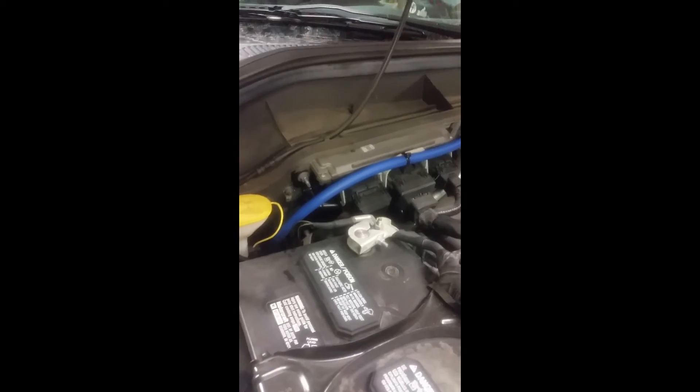Now you can see the filter is mounted to the side of the cab. The oil lines go up into the fender well, go through the fender well, through the frame, and over to the fitting that we installed where the oil temperature sensor was. Then the hose comes up behind the battery in the fender well, up across the firewall.